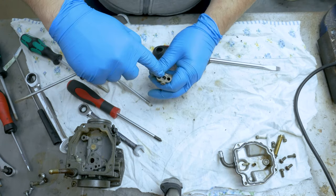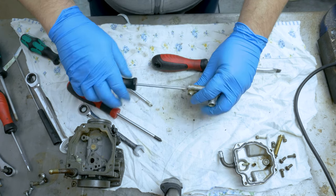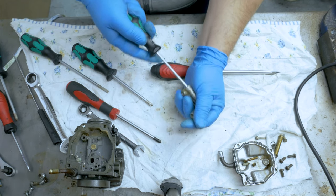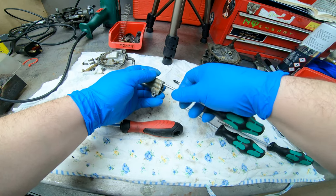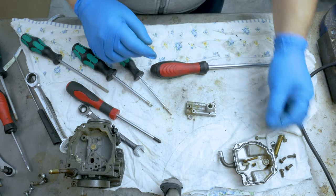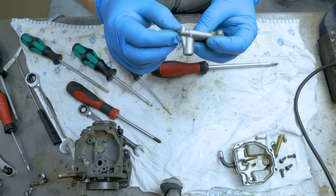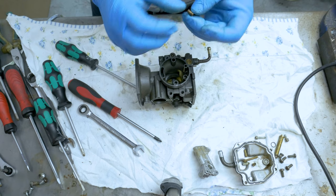Let's get these jets out. There is a jet, there is another one, and there is another one all the way down there. Some of these side holes are half blocked. There's one more I can't even see, so we just go with feel - you can feel the screwdriver grabbing it nicely and it comes out. This could be the pilot jet. That's just a locator hole - it's got a locating pin in there that sticks up, and there's a locator hole which makes it sit in the right place. I think it's a 70.